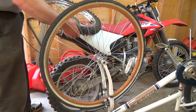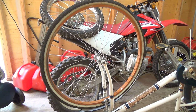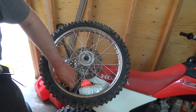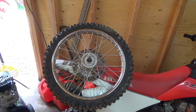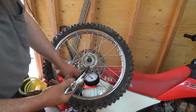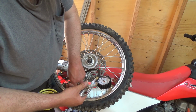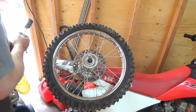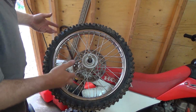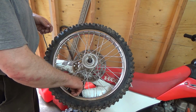Let's just check the pressure on his tire here. I need a workbench. Let's get you guys up over top. Okay, I think I put this one up to 40 when I filled it, and it actually held it for a fair amount of time, but I think now it's fallen substantially below 40, so should put a new tube in, really. Yeah, we're down to like 6. There's 40 again, but you need to ride it, you need to get it moving and going again, and it'll eventually find that hole. I maybe didn't put quite enough stuff in it either, but it should eventually find the hole.